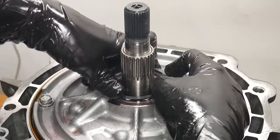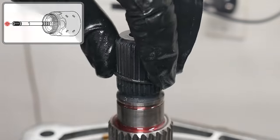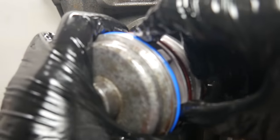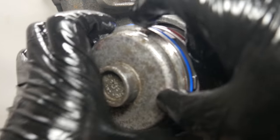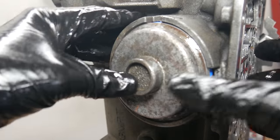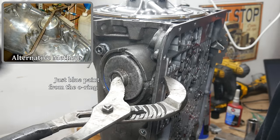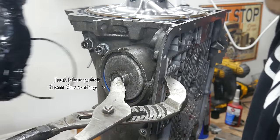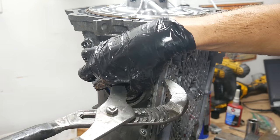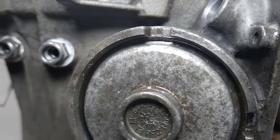Next, we'll apply some oil to the o-ring groove in the input shaft and then install a new oiled o-ring. We'll move to the side of the case and oil the bore where the 2-4 servo will install. Then we can take the entire 2-4 servo assembly and slide it into place. Once it's mostly installed, we'll give it a push to get the servo cover o-ring most of the way into the groove. For the next part, we need to compress the servo cover even more to get the snap ring into place. A large pair of channel lock pliers hooked into the inside of the oil pan's sealing surface works great. It needed a little more encouragement to get the servo cover fully into place. Then we can slide in the servo cover snap ring and make sure it gets fully installed — this was easily accomplished using the rubber mallet and a large flat blade screwdriver. Then we'll take a close-up look to make sure the snap ring is in its groove all the way around.